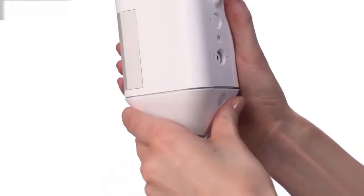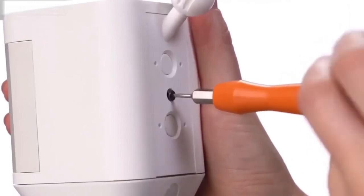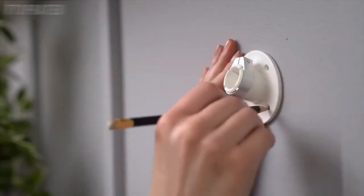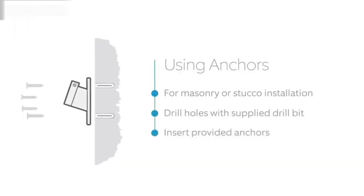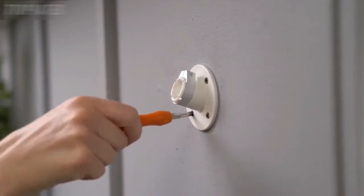Firmly close the battery door until you hear a click. Insert the weather seal and tighten the security screw to lock the plate in place. Once you've identified your install location, use the mounting bracket to mark the holes so you know where to install the bracket. If you're mounting the bracket to a masonry surface like stucco or brick, use the provided drill bit to make the holes and insert the wall anchors into them. If installing on a wood surface, you can screw the install screws directly into your wall.